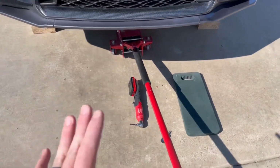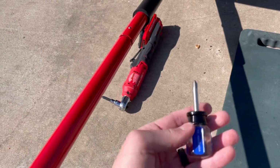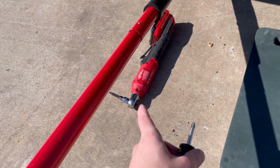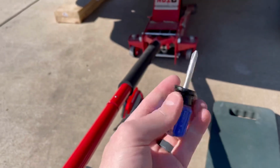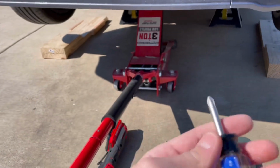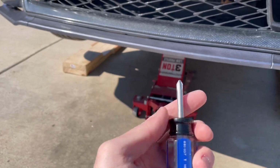And please use a screwdriver and hand tighten the screws if you weren't already. I was using an electric ratchet, but please hand tighten the last little bit of the screws with a hand turning screwdriver because you can feel how tight they are. Plastic is very easy to strip, and you want to stop once you feel it is tight.